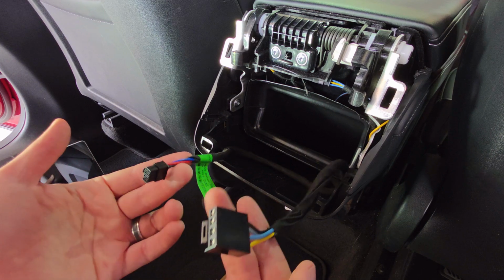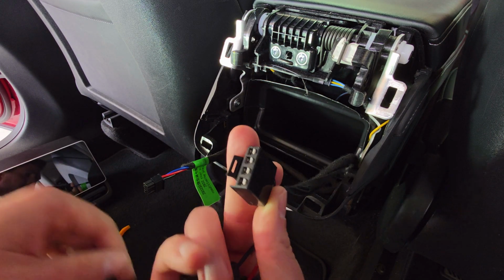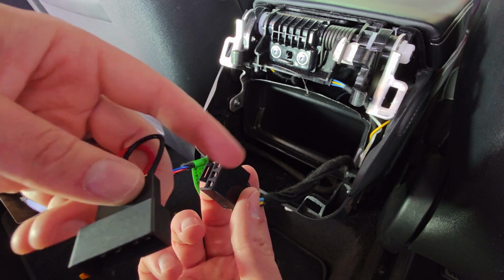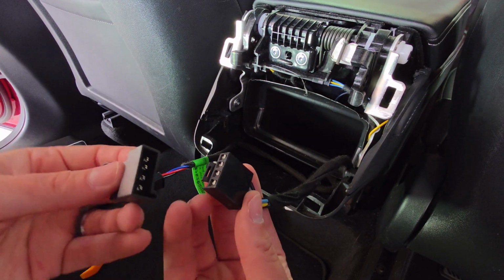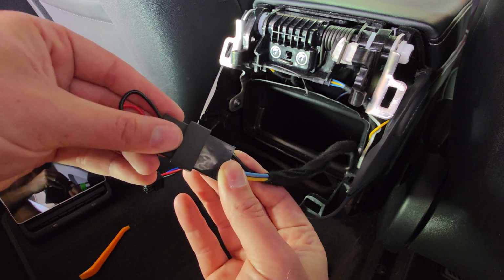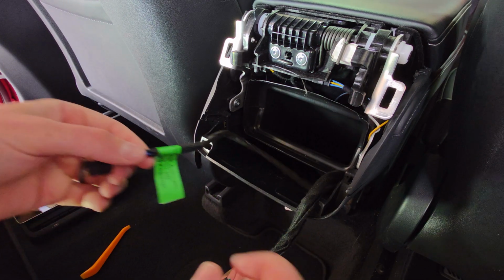So moving back up to the top here, don't be intimidated by all this. It's super simple. You're really only playing with 2 wires here. This is the one that we unplugged from the original cover. And we're going to take our included loop cap and just kind of cap off this wire. We're not going to need it for any of this install, but this still allows power to flow up to your wireless chargers and to your USB ports back here. So you make sure you want to cap this off. There's only one way it can go. See this little extra lip right here plugs into that side right there. So plug it in, you get a nice satisfying click. And then you can tuck this wire away. We'll do that in a second.